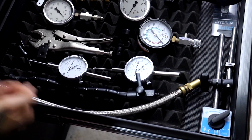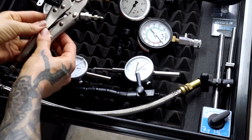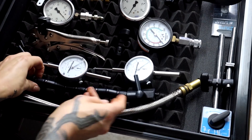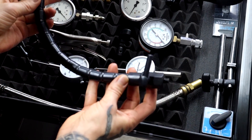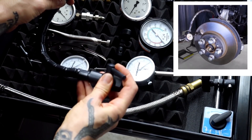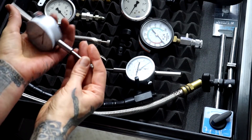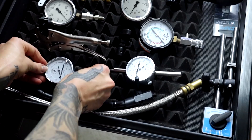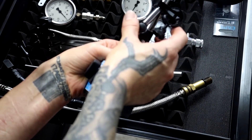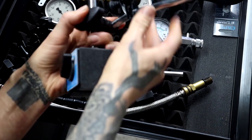We've got a few different dial indicators we can use. This one is one of my favorites — it's a clamp style with a threaded piece and a nifty gadget that threads in there. You can put it in any shape you want and lock it into position just by turning this dial. But the one I'm going to use today is this one with the magnetic base — pretty much every single axis of this is adjustable.